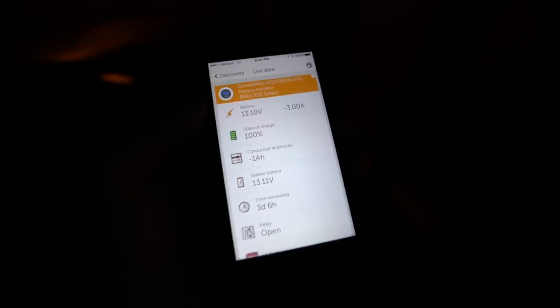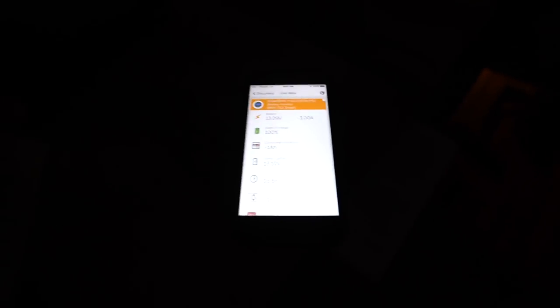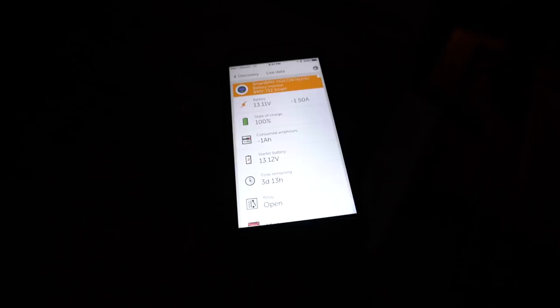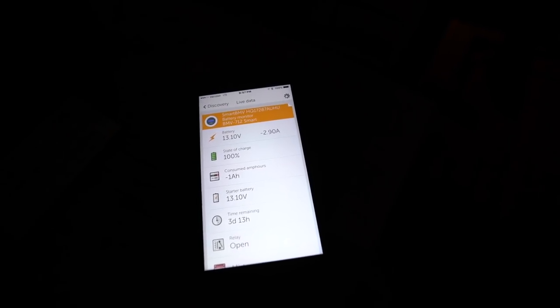I'm in Medford. I'm going to try and get maybe two hours into California — I think I'm still about an hour away from the border. I'm hungry, tired, and got to go number one. This is a real-life battery usage app showing what the bus is using. Right now I'm using three amps. Watch what happens when I turn the lights off — it will jump down. And now I'm only using one and a half amps. Pretty cool. So you can see these lights are about one and a half amps.